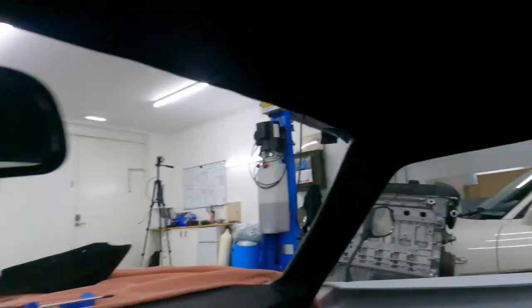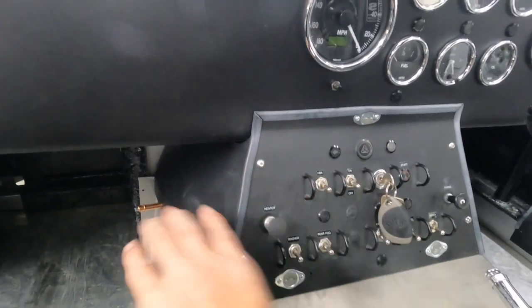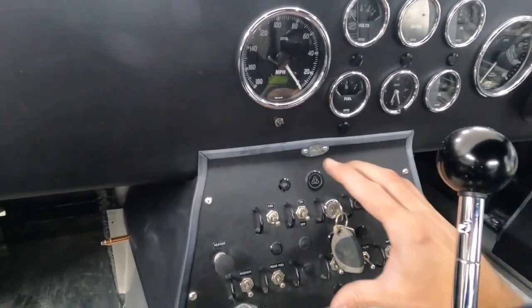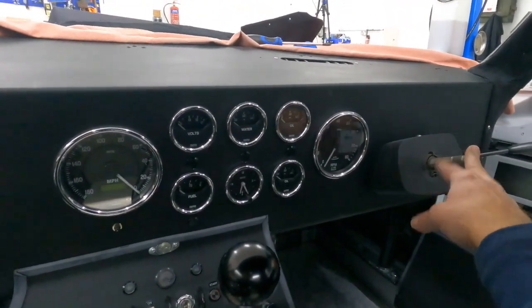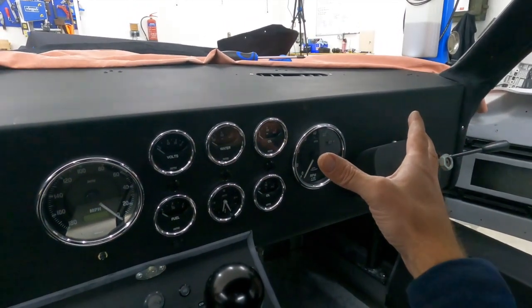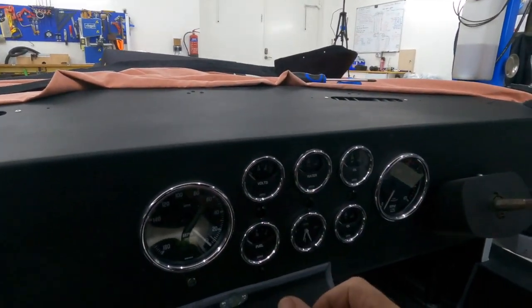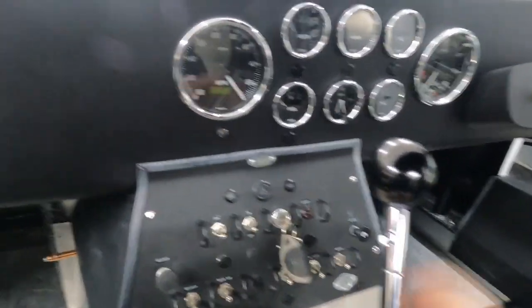So I'm going to take this side out. The door edge and center console side panels need to come out - same on this side. This panel leans forward but is wired in the back so it doesn't come out completely. I undo the twist fittings to release it from the dash. Then I need to take out the steering column section cover, the indicator stalks, and the horn. After that I can pull the dash out and get to the back of it, undo the clips with all the electronics, and pass it out forward.